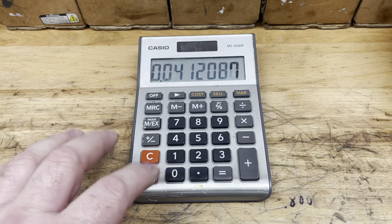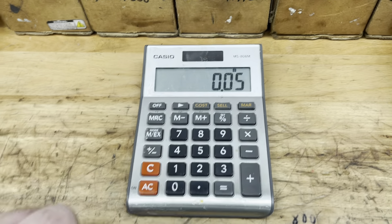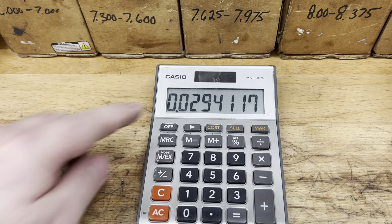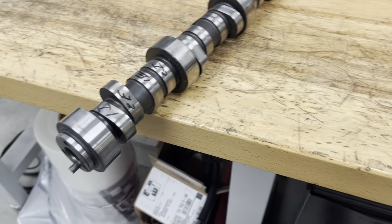Remember, if we're dealing with an LS1 or LS6 and we had 50 thousandths divided by the rocker ratio and we are 30 thousandths off the bottom, we probably couldn't get away with going 25 thousandths longer on the push rod — that would be a little bit too tight.